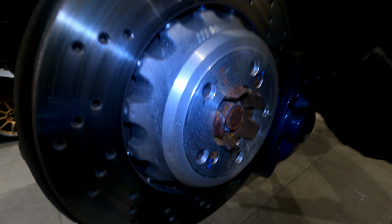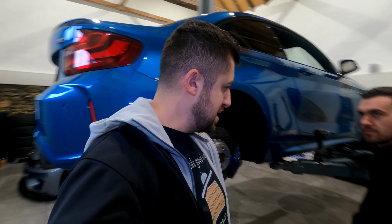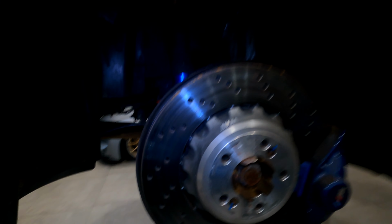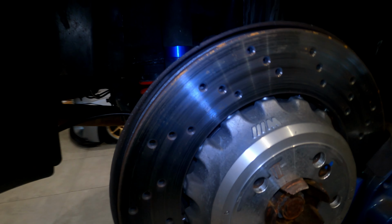Nice. So, on the first lap video of the year, not only did I cry, but also BMW cried, or its brakes. When you broke hard, it was... Yeah, exactly. And since we put Endless pads in there, we asked Endless, is this normal? And they said, you should probably look if you have some pad deposit on the discs from the old pad, which causes the brakes to squeal.